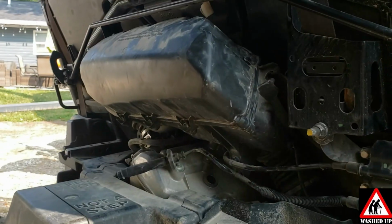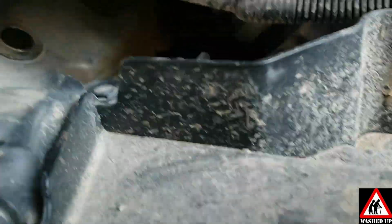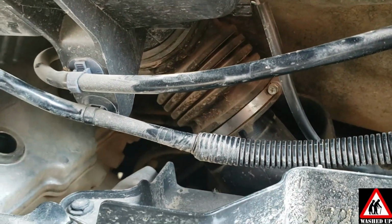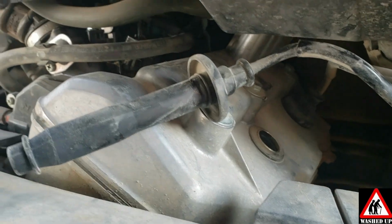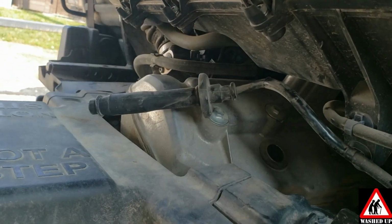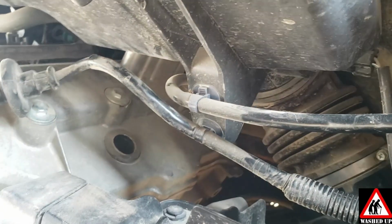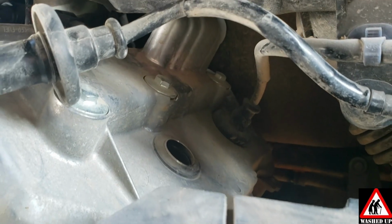It's kind of intimidating, but there's two bolts, one on each side there, and then there's little clip deals up there at the top. They tuck in underneath that bar, and then got a clamp coming from your front snorkel piece there back, and then you've got two on your throttle bodies. You got to take off, and then looks like that'll come up out of there. And then spark plug boots weren't too bad, pull up out of there, but couldn't get to the back one with all this stuff kind of in there. So that's why I decided to take the air cleaner box out.